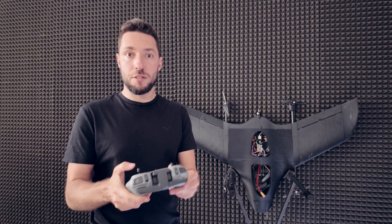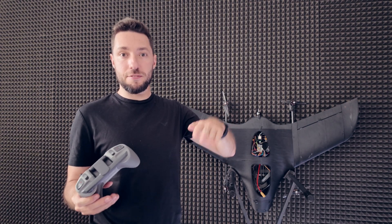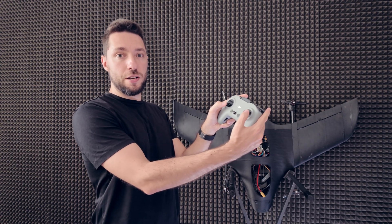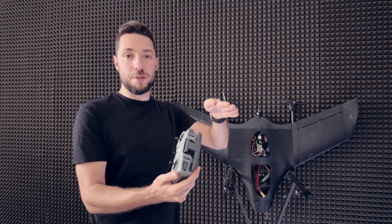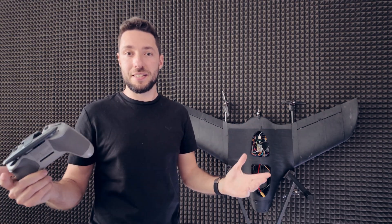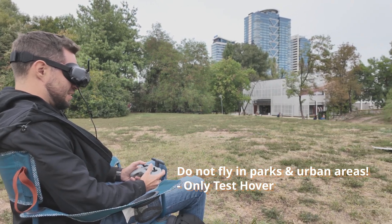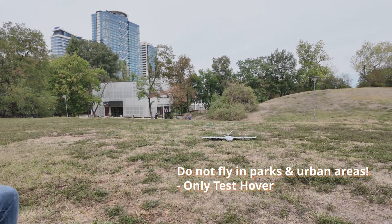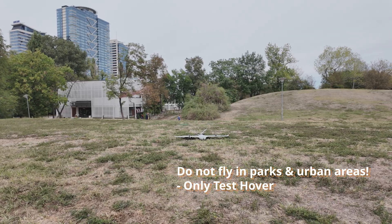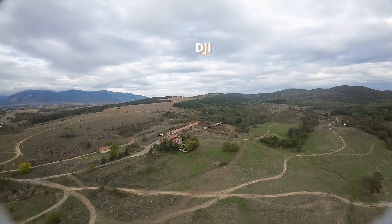If you're in manual mode, it will perform just as you expect, but if you're in fly-by-wire, it will actually perform stabilized flight. For example, if you try to put the drone to roll more than 30 degrees, it wouldn't let you — it will just slowly do a stabilized turn, which is amazing for beginners like me. But if you want to do acrobatics, you can turn it into acro mode and go wild. This remote controller provides real-time control within visual line of sight, up to about 10 kilometers. It's an ideal solution for FPV enthusiasts, as it can also be paired with an FPV camera and goggles, and you can see what the drone is seeing in real time.